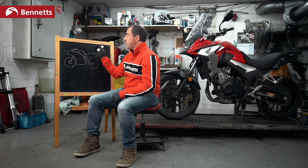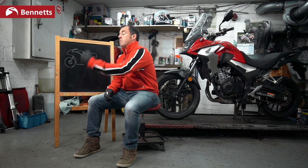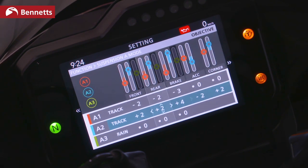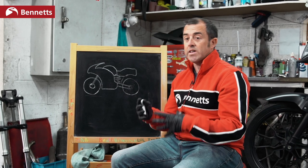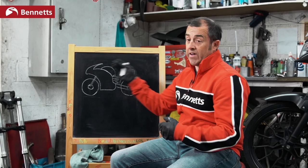Now the brain of the bike controlling this and the fueling is monitoring wheel speed, but our systems have got more advanced. They're also monitoring throttle position, gear, and crank speed. They may be taking air temperatures or doing lambda sensors. It depends on the sophistication and the system that each manufacturer uses.